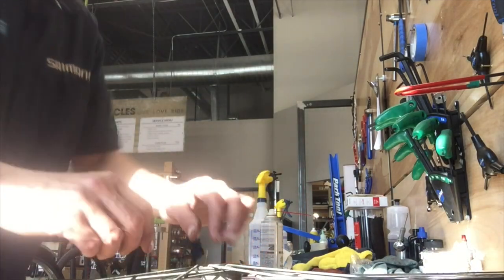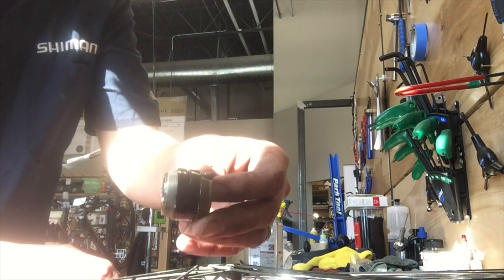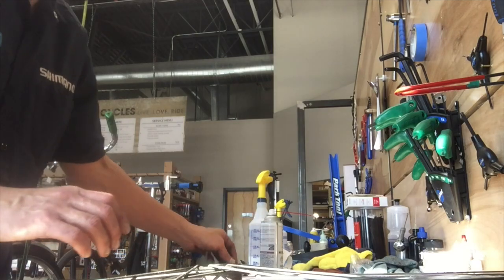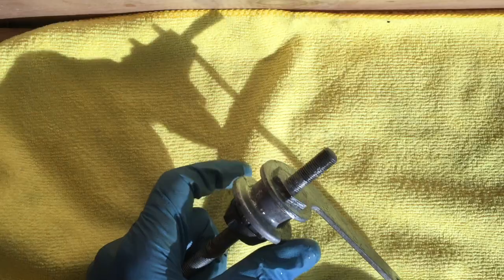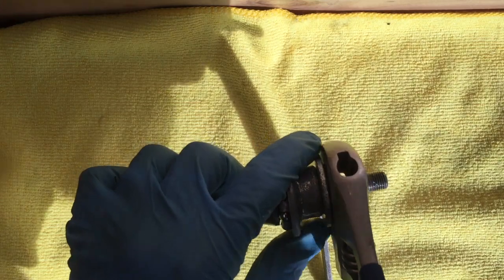The Bendix 70 uses two brake pads; the 76 will use four smaller ones. You've got your retarder assembly with your expander, the clutch, and then the retarder spring all in one assembly. That's pretty much it — we've got an empty hub shell from here.